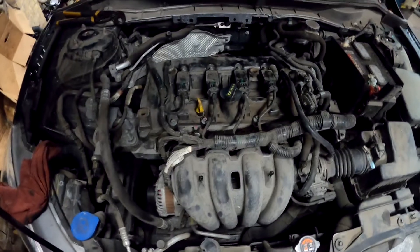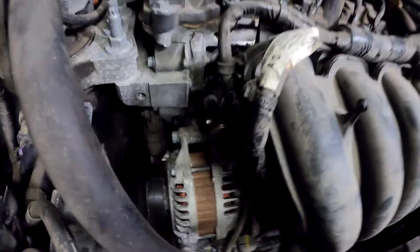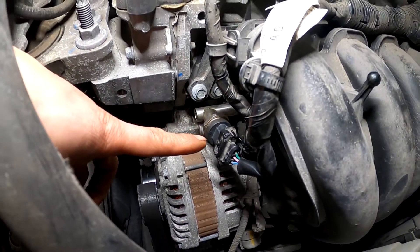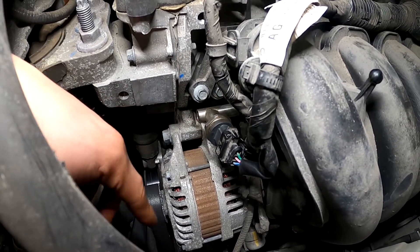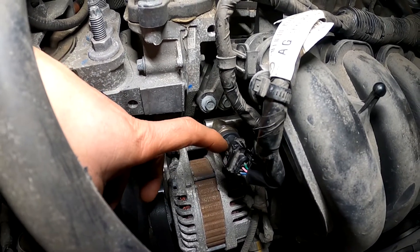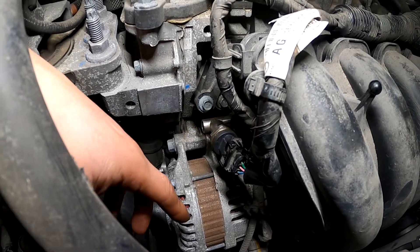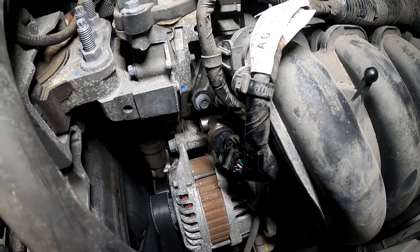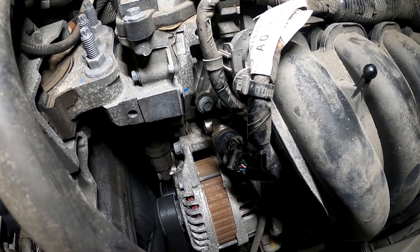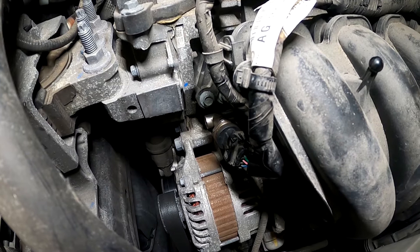This is the engine, and it turns out it's a Mazda engine. The way I figured it out is I grabbed the numbers from the pressure sensor right here and punched them into the computer. It turns out it's the same as a 2007 Mazda CX-7 with a 2.3. So if you guys get a code of P0193 and want to save some money, just look up that number and it will give you a whole different options of where to get it from.